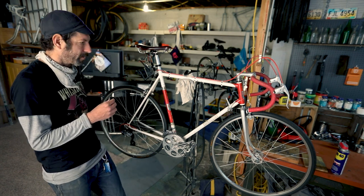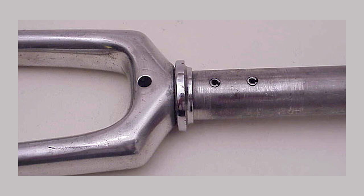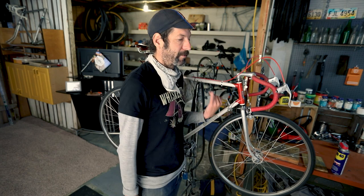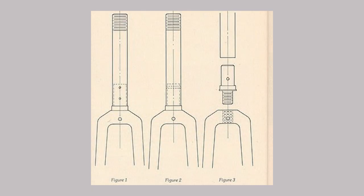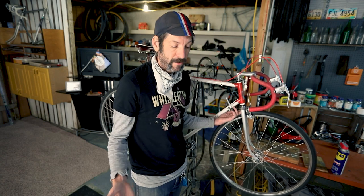Another unique feature — the big elephant in the room that everyone knows these bikes for — is this aluminum fork. It's cast aluminum, to get the weight down, also known as the death fork. It got that name because the early version of the aluminum fork was not attached very well to the steel steerer. With a couple of pins going through, they were known to break — the estimate is about one percent of them were breaking. So not crazy, but if you're one of the one in a hundred people that went over your bars, you weren't going to be happy. They made a second version where they changed the way the pins were, but it wasn't good enough. Then they came out with a third version where they put steel all the way through and put the brake assembly through it — that's what this version is. You can tell by pulling off your wheel and putting a magnet there; if it sticks, you have the third version.